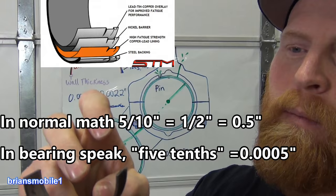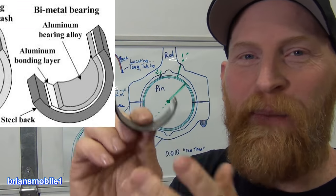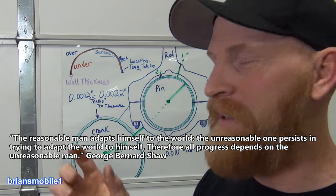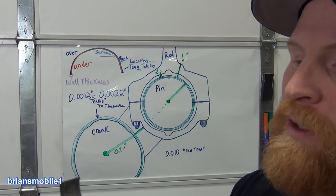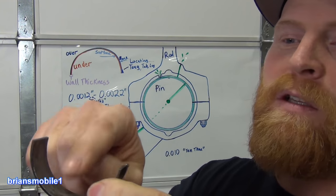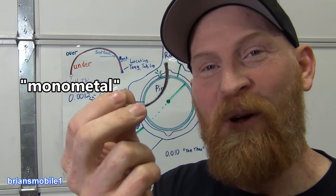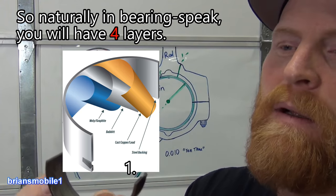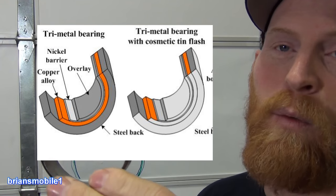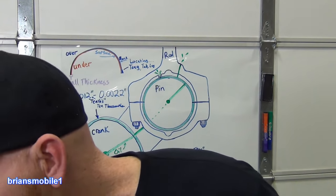Remember this bi-metal bearing has three layers of three different kinds of material, but it's called a bi-metal bearing — that's just how we do this. It is an unreasonable man that expects the world to change to him; it is a reasonable man that changes and learns to fit what they're doing in the world of bearings. A tri-metal bearing for a high performance application — with stronger crankshaft materials so they don't flex — can get away with having a stronger surface to handle harder loads. For really high loads in industrial applications and high speeds, they use all-aluminum or mono-metal bearings.